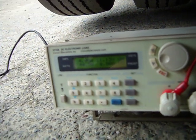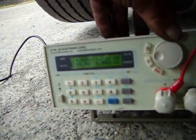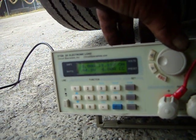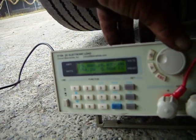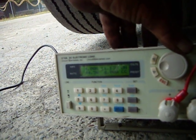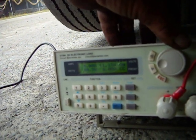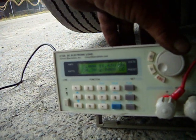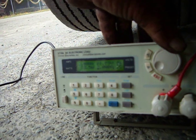I think there's only a 5 amp fuse on the key switch wire. I'm not sure, but I'm not going to run it past 5 amps. At 5 amps it's 10.81. At 4 amps it's 11.13. At 3 amps, 11.4. At 2 amps, 11.73 volts.